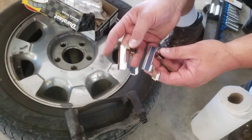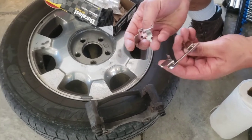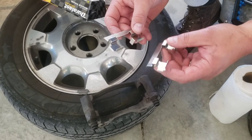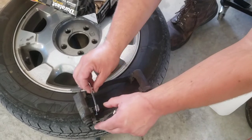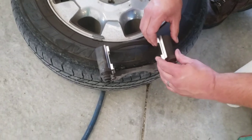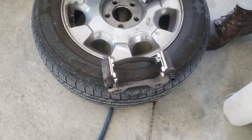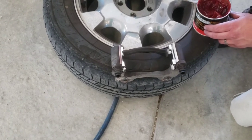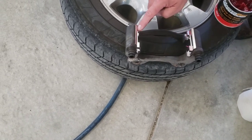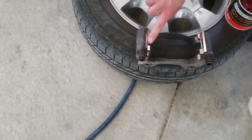Time for some parts swapping. I've got my assistant, my young son Riker, out here helping me do this stuff. These are the replacement pad slider thingamajigs. Luckily on this Cadillac they're the same — I've done a Chrysler where you about lose your mind because they're like 30 thousandths difference and they don't just neatly fit on. So these guys just snap into place and press on, it's really easy. Except for that one — a little stiff, but that's okay. I'm gonna put a little bit of grease on the surfaces where the pads slide, just using a little bit of wheel bearing grease because I've got it handy and it doesn't really take much to do the job. I'm sure there's mechanics out there that may be cringing, but you know something, it does work.